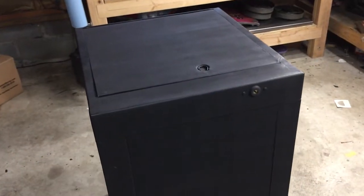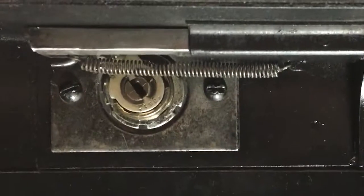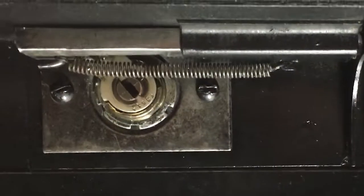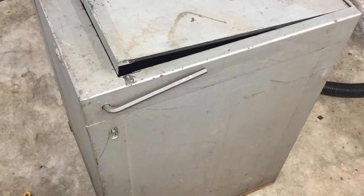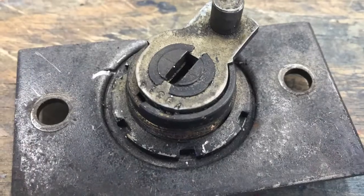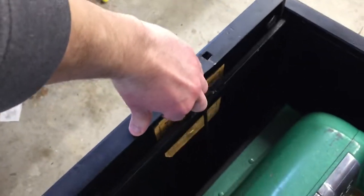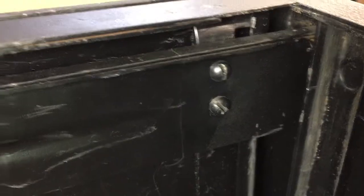To unlock the stand, you insert your key and turn from left to right. With the spool out of the way, you can see that the key unlocks a spring-loaded aluminum rectangular piece, which locks automatically when you close the lid. When I first got the stand, I didn't have a working key and accidentally locked the machine in it. Fortunately, I managed to get it back open and had the lock re-keyed by slot expert Larry Dubois. With the cover plate unlocked, it slides back into the rear portion of the stand and is held in place by two pieces screwed into each side at the top and by two L-brackets on the bottom.